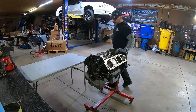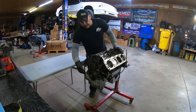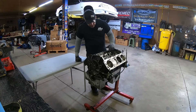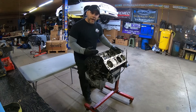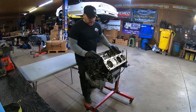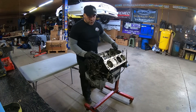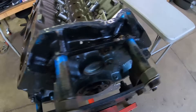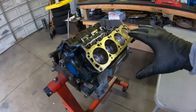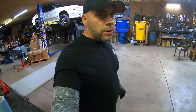So this is the format of the video. We've got some small parts to still get off - the pulleys, the gear, the oil feed, lifters. We're going to take pretty much everything apart because it's got to go back to the machine shop. We're also going to take a look at some of the pieces and see if maybe I cracked the main. For being three and a half years, that's got to be one of the cleanest blocks I've ever taken apart. I was always very adamant about changing my oil with as much abuse as I had on this motor, plus I didn't have a whole lot of timing in the tune.